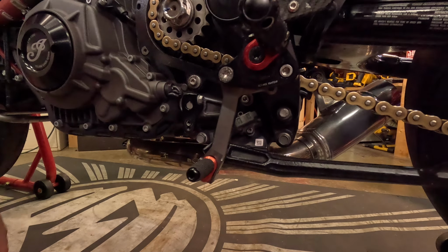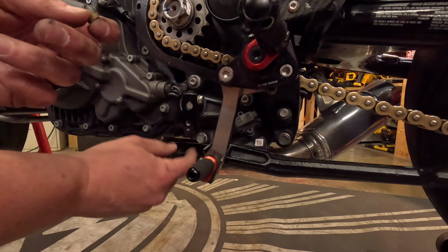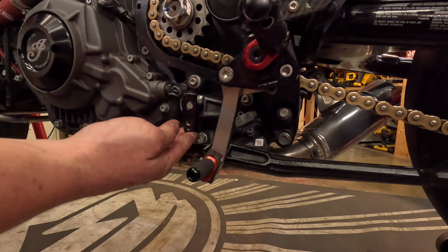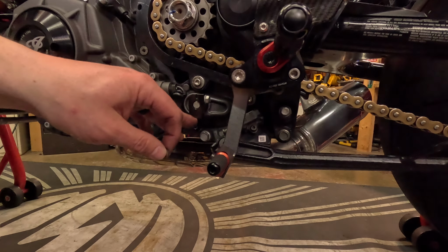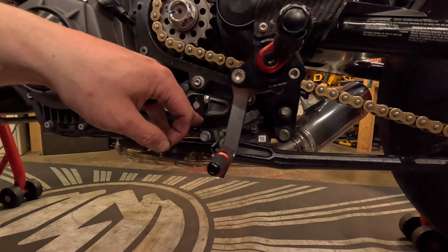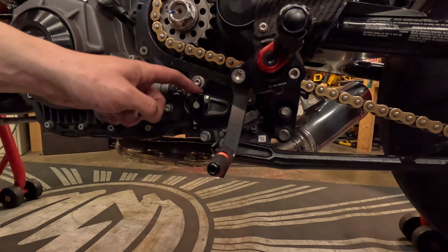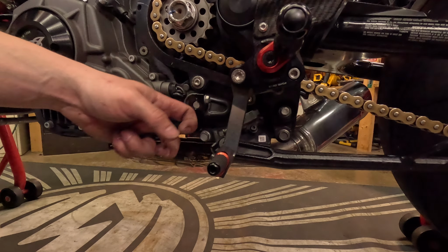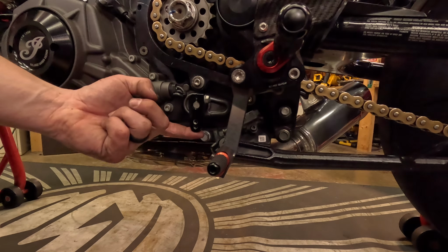And then this GSXR arm, this little bushing that goes up there. These come off eBay. I'll throw a link in the description where to buy them. They're like 13 bucks. What this does is it moves your shift point up further, and it shortens your shift throw, especially on the 2019 bikes that had the clunkier transmissions. This greatly helped reduce false neutrals from 1 to 2 and from 5 to 6. So great, easy, cheap mod. This one also fits all your FTRs and fits the Challenger.